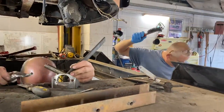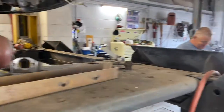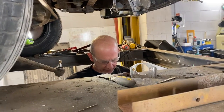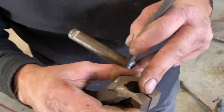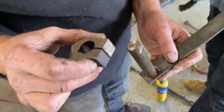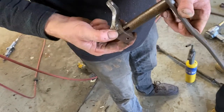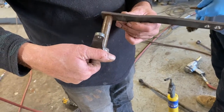That's going to be one leg. It's going to be driving on that. Excellent. All right, cool. I think this would be a very unique bus, wouldn't it? I think a modification might be required. Actually, in fact, the keyway's in totally the wrong place. That there is the slot for the bolt hole. And this is the slot for the keyway. The keyway runs into here. So if you were to line that bolt hole up with that, which would be out that way, then the keyway's miles out. That far out. Interesting. So our kit is wrong.